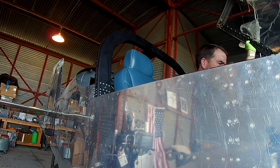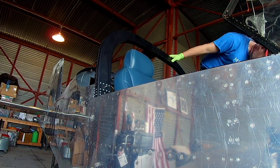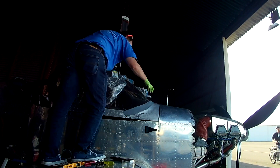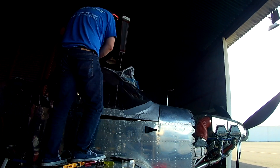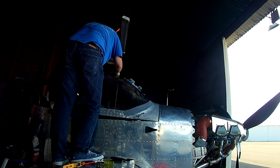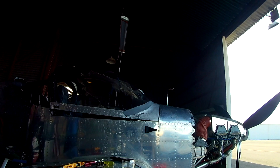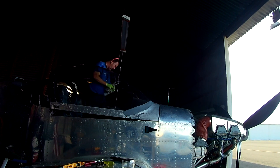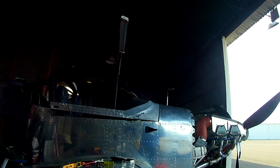Those all work and are happy. As soon as you latch that thing shut, the G3X has a beautiful discrete mode just for the canopy open warning specifically. Be careful though, because once you set it, it basically gets locked in place. I don't know why, but once you set it as the canopy latch, I haven't been able to change it, so just be careful.